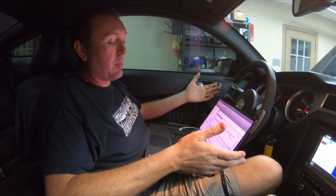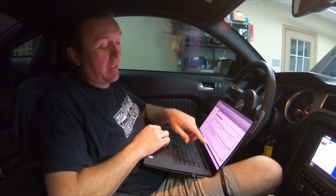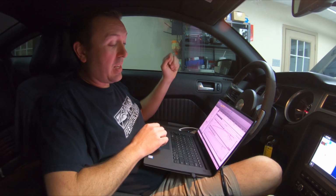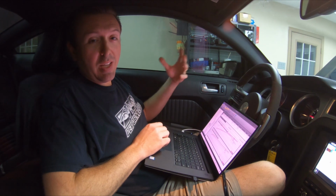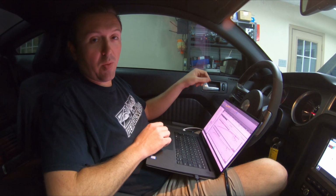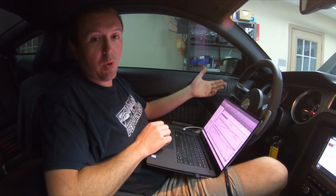So this is a very common setup. The car made 729 peak once again. At that 6250 RPM stock rev limiter, it made 710 rear wheel horsepower and just under 20 pounds of boost. That's about 25 rear wheel horsepower more than the 3.0 pulley at the same point. So we're getting 10 to 15 horsepower per pound of boost per 1/10 of an inch of pulley size, right in line with what we'd expect.